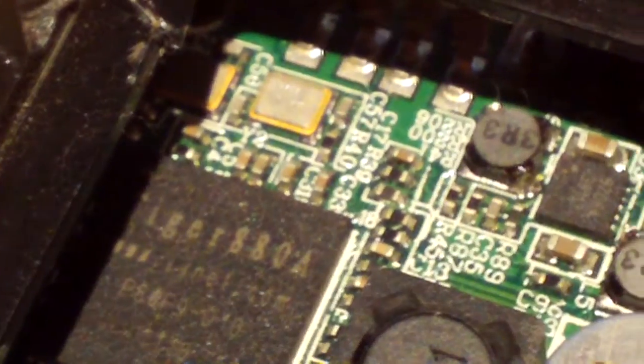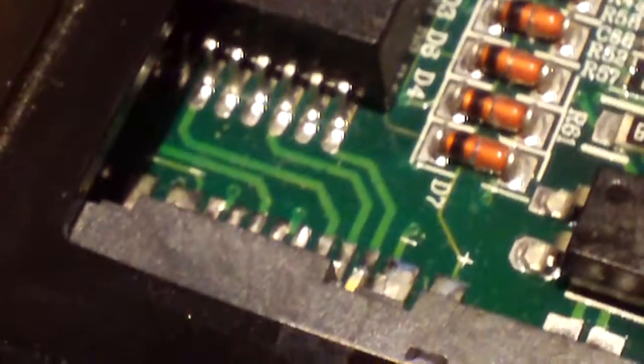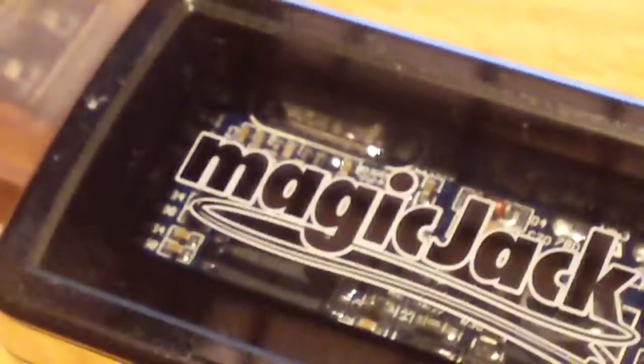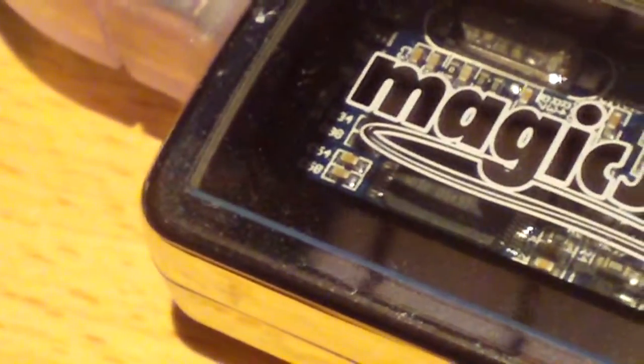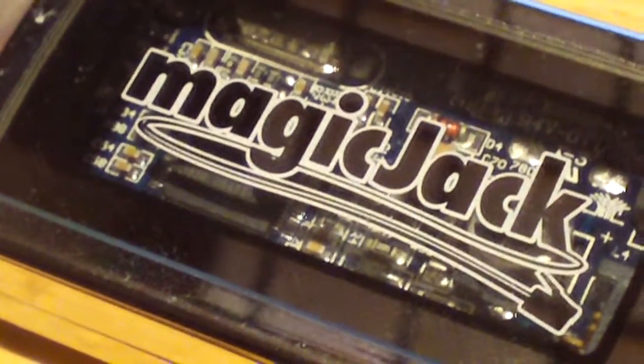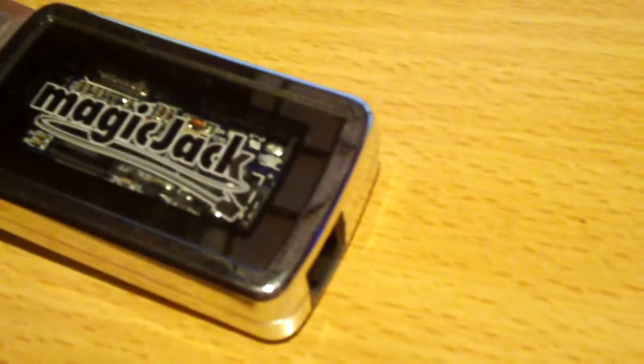This microprocessor here knows how to work without the computer, and it can also more or less work in compatibility mode where it can actually run like a standard MagicJack. But this design here is what makes the MagicJack Plus work so much better than the standard MagicJack when it's not hooked to a computer — because it's a simple system on a chip. Unlike a MagicJack connected to a PC, in that case your processor is having to do a hundred-something other things. You have magicjack.exe plus possibly up to a hundred more processes on your processor doing other things, so your computer's processor is very busy. Whereas on this guy, the only thing it really has to worry about is making your phone work.